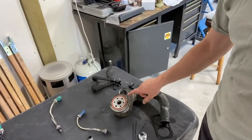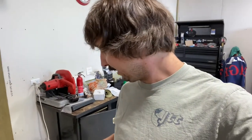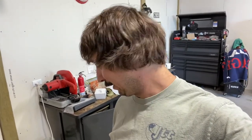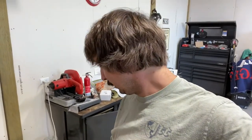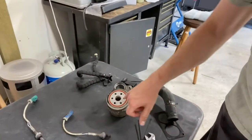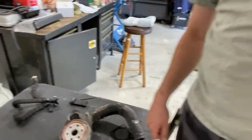If you've never taken a bath in coolant before, this will be the project where that happens. I had to do a little outfit change in between filming because I just got absolutely covered. To get this piece off right here — this is your oil cooler — on one side you've got engine oil, on the other side you've got coolant. Obviously you've got to drain both in order to remove this. Even when you remove the lower radiator hoses and let them drain, you will think you got everything out. I'm here to tell you, you won't. There's not an easy way to do this. You're going to spill a lot of coolant on yourself. Safety glasses may have been a good idea. There's a bolt in the center — that's the half-inch hex. The rest is just getting in here to get these hoses loosened to pull this thing out.